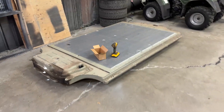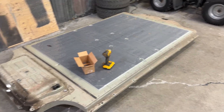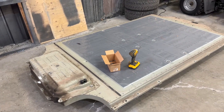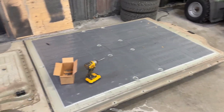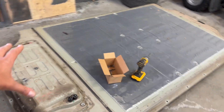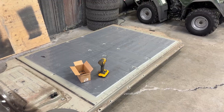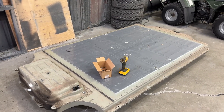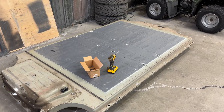This is hands down the scariest part of this build. This is a 400-volt battery bank and it is considered high voltage. I've already started to take it apart. I'll take this front cap off first — I've watched several videos on YouTube of people dismantling these. I'm just going to wear my high voltage gloves, take my time, wear my rubber shoes, and stay grounded.